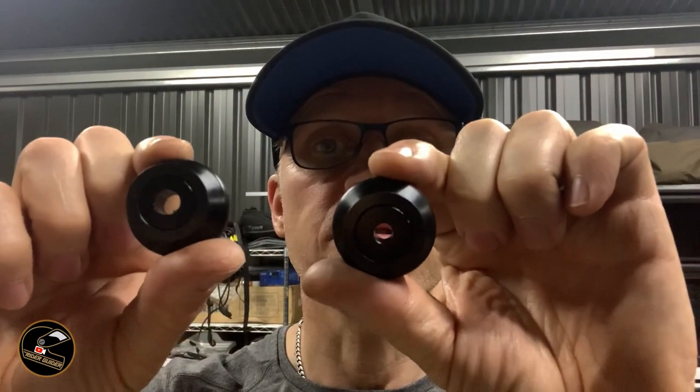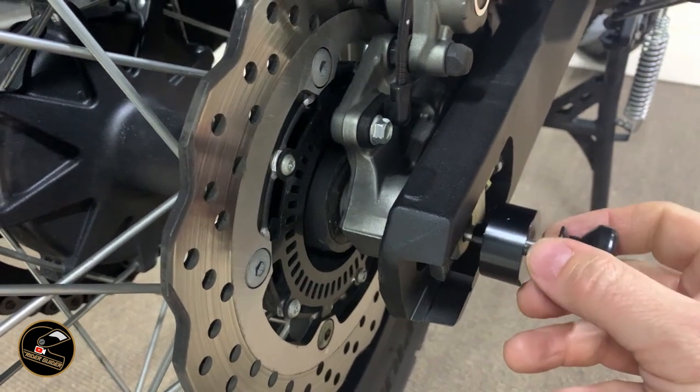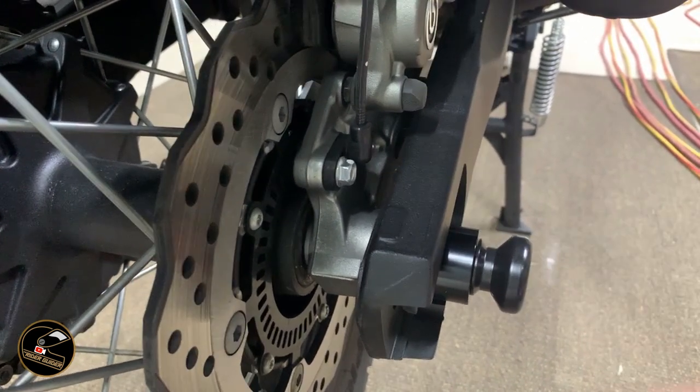So we've got that installed, thread lock in place, we're happy. Next is to install one of these bobbins. There are two bobbins, one for each side, but they are different — look at the size of the holes. The right-hand side bobbin is bigger. Simply slide that on — bang, done. Next, get your spacer. The one with the little nubbin on it goes to the inside, so it sits flush. Push that through the axle spindle on the bike, in she goes. Make sure that spindle spacer sits flush in. Push it home. Remember, your washer's got to be the right way around — don't forget — or I'll haunt you. That side is done.